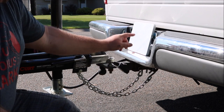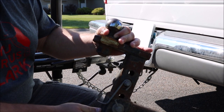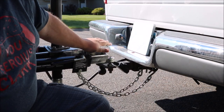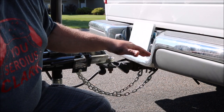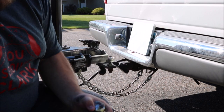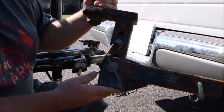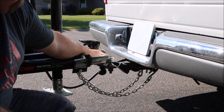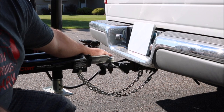How you'll adjust that is with your riser hitch. This contraption here is what we used when we were towing with our minivan — this is about an 8-inch rise, which is what we needed. Because keep in mind that when your trailer is sitting level on the jack, that's not going to be your ride height. It's after it's hooked up to your tow vehicle and the weight has pushed those shocks down a little bit. With the minivan it dropped quite a bit, so we needed this large contraption to give us an 8-inch rise. Now we just have a 2-inch rise; if we would have found a 2.5 or 3-inch rise it probably would have brought us up right to where we needed to be.